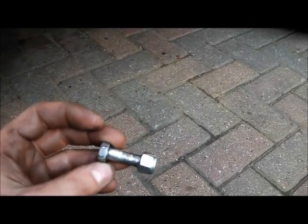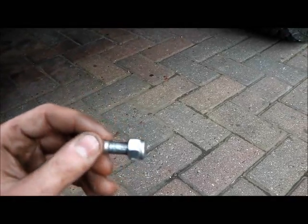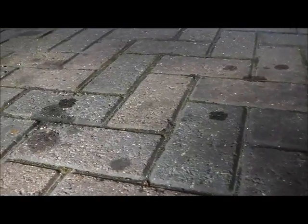The rear prop is now properly torqued up, though I had to change another bolt - you can see what was happening to them; made out of cheese I think. It hasn't leaked overnight, so we'll go for a little test drive and see if it's done the trick. Of course it leaks from everywhere else, but if there ain't oil under it there ain't oil in it. About a 10-mile test drive up to about 50 miles an hour, a little warm-through, no leaks - so a long journey to do tomorrow, fingers crossed. So that's how you change the Salisbury diff seal. There are other ways of doing it, but this has worked for me. Hope the video is useful, and thanks for watching.